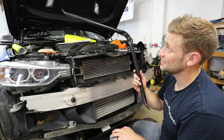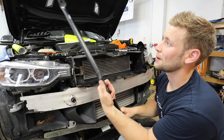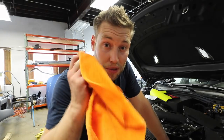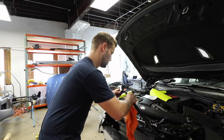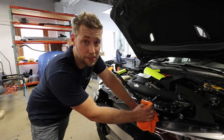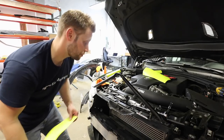Someone's going to ask why I'm not powder coating it — the reason is it's bigger than my oven and I already bought the vinyl, so no big deal. Before applying vinyl, make sure everything is clean and dry. Get a microfiber towel, put some rubbing alcohol on it, and clean it up. To make it easier to work with instead of holding it, I put one of those T30 bolts back in where the bumper was secured to give me a little stand.